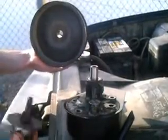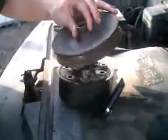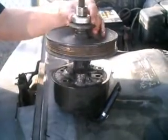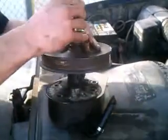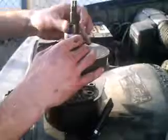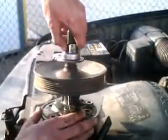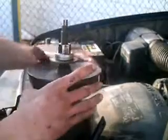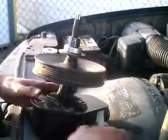So what we're going to do it on the vehicle because we have to bolt it back onto the engine bracket. Basically, we're going to put it on. Screw that down. Have a large wrench to hold it here and a ratchet here. Just keep tightening it and press the pulley on, and remember to do that after you have it mounted to the bracket.